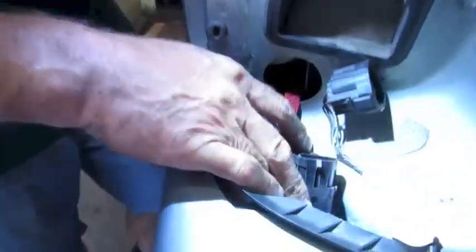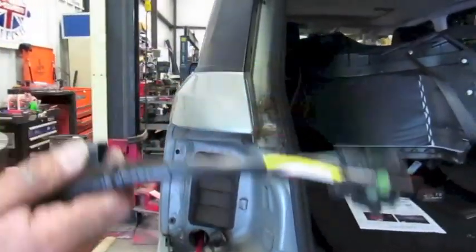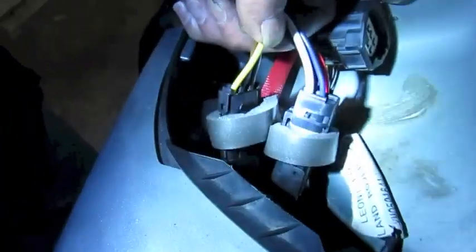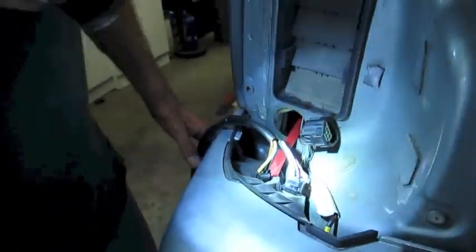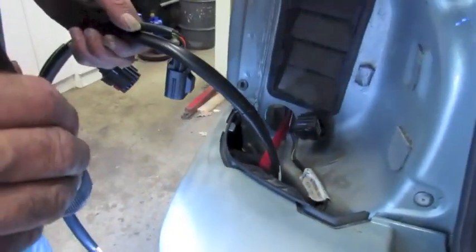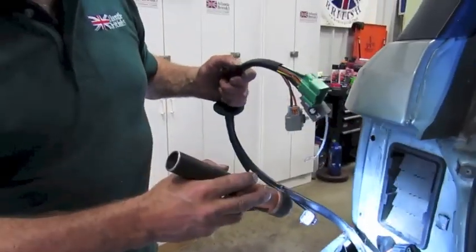Here's the pigtail harness coming through behind the bumper right beneath the lamp assembly. There's another section of wiring that attaches to it here via two connectors, and this is all then routed through this hole into the back of the vehicle. The two connectors — the rectangular one and the square one — are connected. The two pieces of foam tape that come in the kit wrap around there to stop it from rattling against the body of the vehicle. On the outside we also have the park distance control connector and the grommet that plugs the hole at the back of the vehicle.